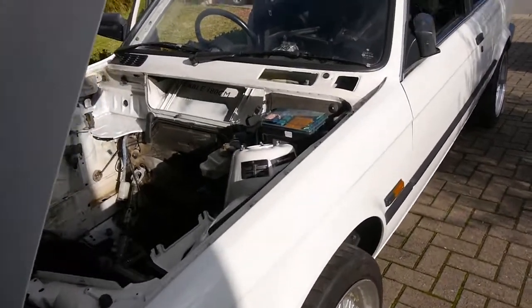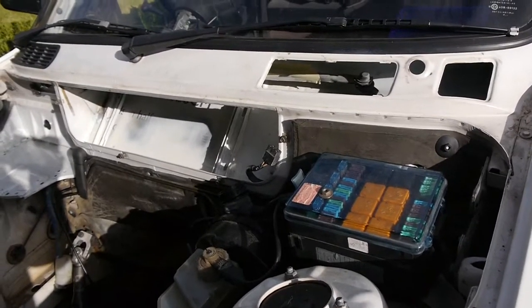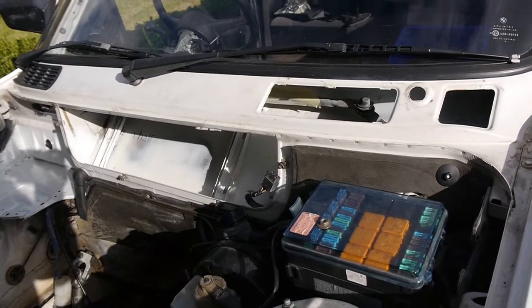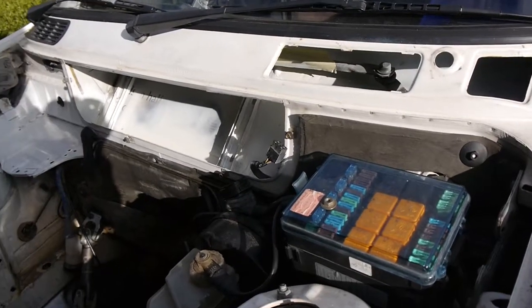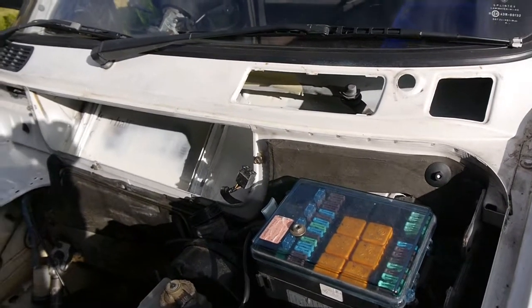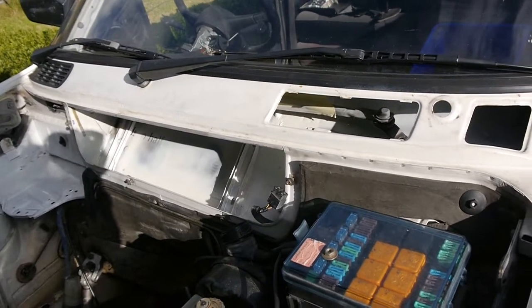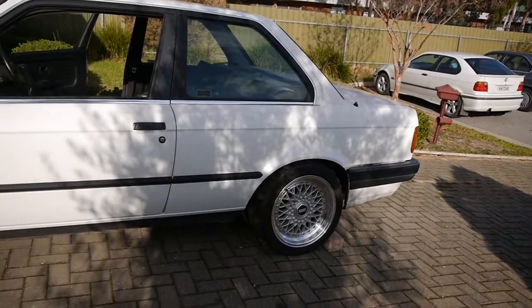One of the first things I got into during that time is getting rid of all the rust out of the sill panel. Removed the wiper motor and just made sure the water can go where it needs to — it's not sitting anywhere, there's no rust in there. It's a pain to get back in there in the future, so I want to make sure while everything's out of the car, it's perfect.